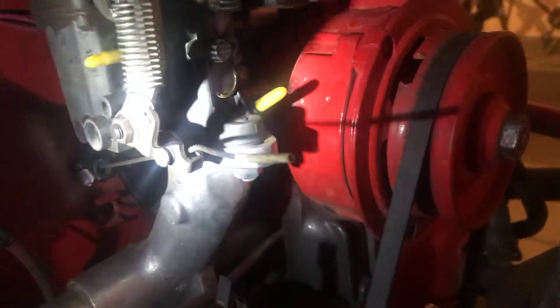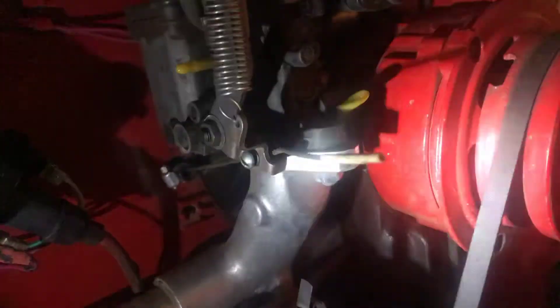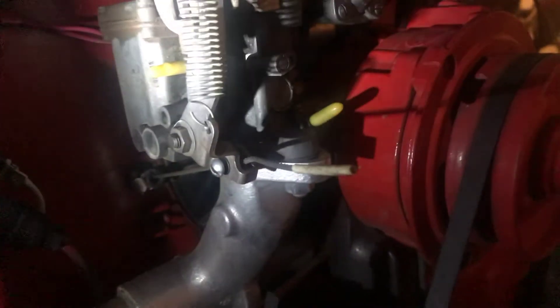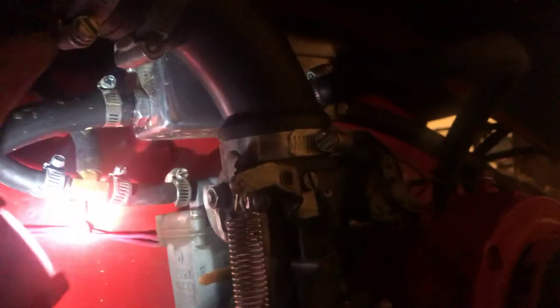These yellow caps — do not replace them with a hose and a screw stuck in the end, because the threads will still leak air and you'll run like crap and never know why. Replace those caps once a year because they're cheap China garbage and they'll dry out and crack.